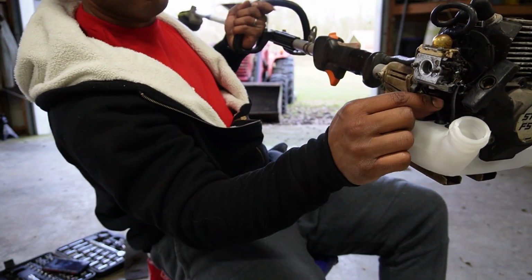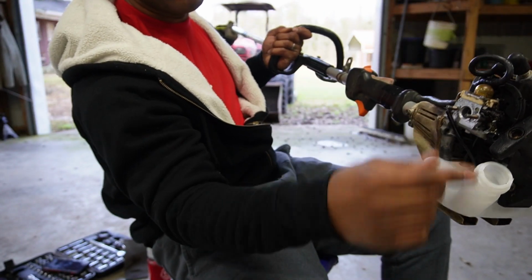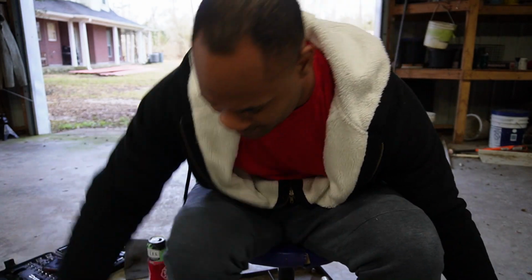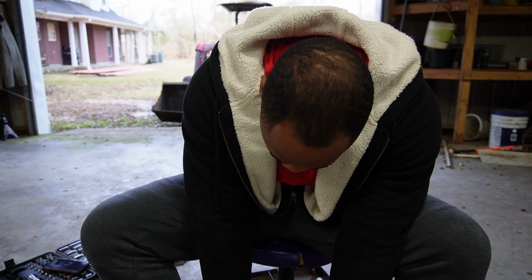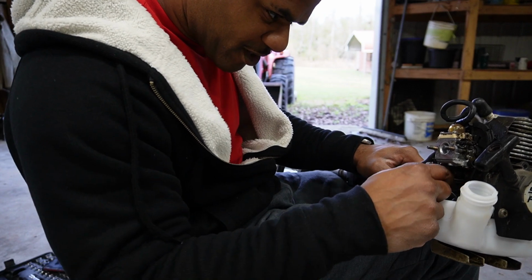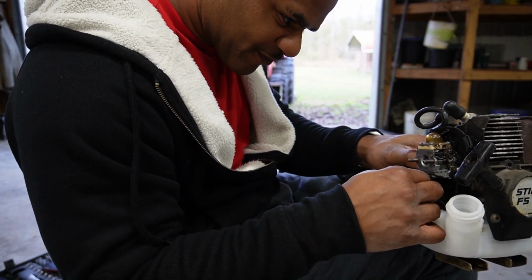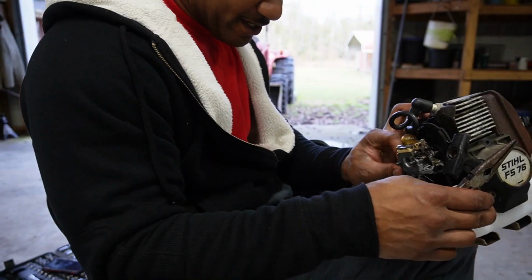Okay. Boom, one goes there. We have to pull that a little bit. And one goes here. Let's pull that out a little bit. It's a little shoved in there. Take our needle nose, pull it out just a little tab, not too much. The reason why we're pulling it out is to make sure it goes on the carburetor, you have enough to go on the carburetor and you ain't, you know, short, because if you ain't getting no fuel to the tank, it ain't gonna do you not a bit of good.